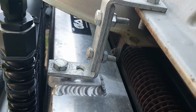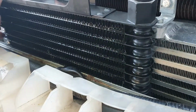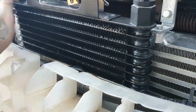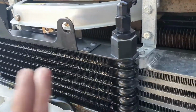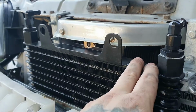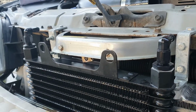There's not much gap between the transcooler and the intercooler. But I'm thinking right now what I'll do is I'll undo these two bolts, drop down the intercooler and see. So hopefully we can, and it'll bring the pipes up a bit closer too. And then I'll give you all a rundown on how the piping and everything was set up, and we will get to the transcooler last. So we'll do a time lapse now. I'll unbolt this, lift up the car and drop the cooler.